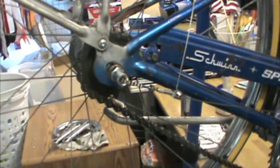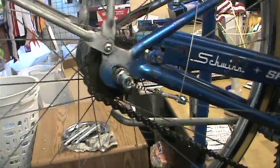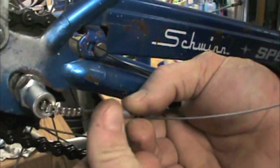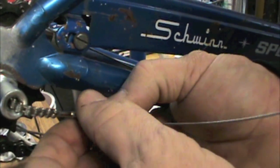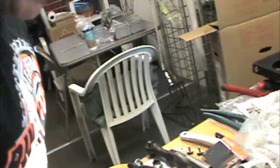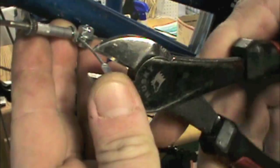The rear hub on this bicycle is pretty beat up — it got pretty hurting pretty badly. We gave it a little loving, a little rubbing, and she got better. So now my cable is right, it's on the money. I'm going to take my lock nut and cinch that up to that, and we're done. We have to give that a little crimp and put a little cable end on it. Cut this down a little bit — leave it about an inch showing. If you order a 3-speed cable, we're going to give you a couple of these little cable end caps too. This goes right on the end to keep everything nice and neat and non-fraying. There you have it — 3-speed cable installation and adjustment on Sturmey Archer. Not a Shimano — we'll get into Shimano when I get to a Shimano.